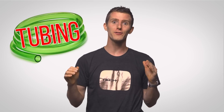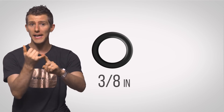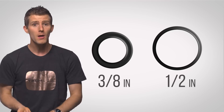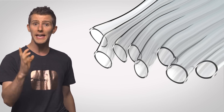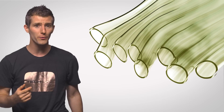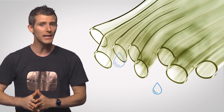But what do you actually need? Well, first up is tubing — it's not going to work very well without that. Pretty much any kind of tubing will work. 3/8 inch and 1/2 inch inner diameter tubing are the most common. But don't go to the local Home Depot and buy the cheap clear vinyl stuff on the shelf — it will kink when you make tight bends between components and can stiffen and change color over time, which looks grody and can actually make leaks more likely to develop at the fittings.